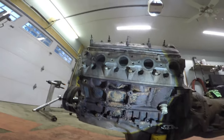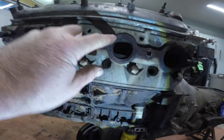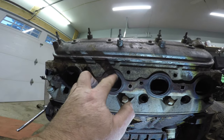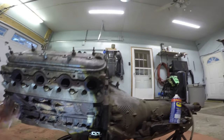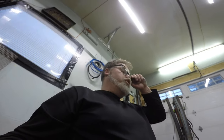If we put the gasket on you can see what I'm talking about — see how much more you can take off the head at the top of the surface right there. We can smooth all that out and it'll make the head breathe out of the hole a little better. If you're under boost it doesn't really matter because it will push it out, but I'm going to run normally aspirated — maybe.